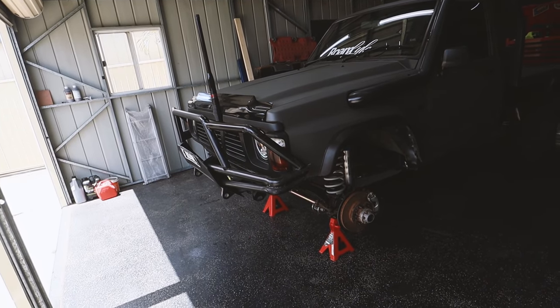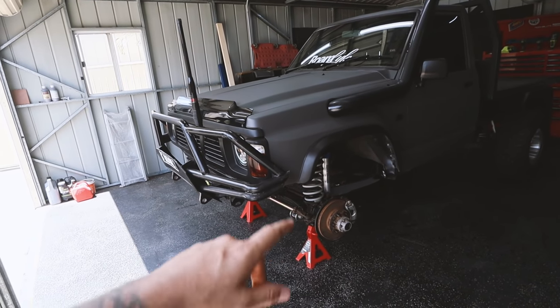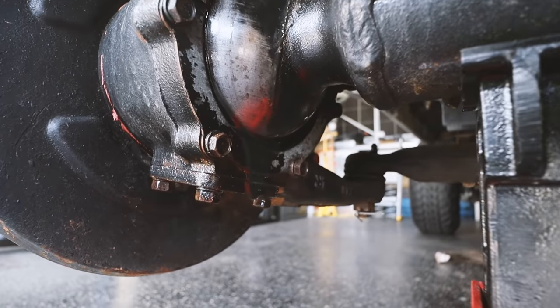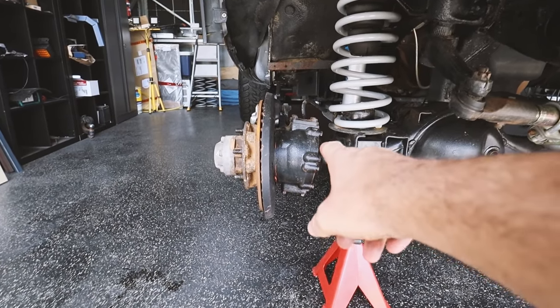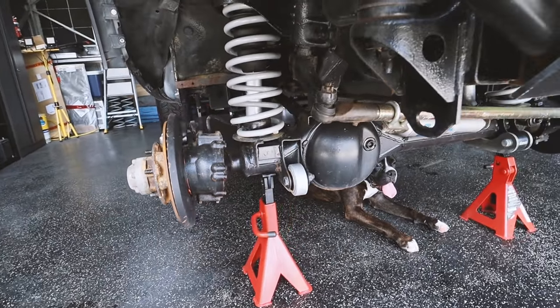That's probably the first thing you should do, because going into the axle side of things, the diff oil can run out. I think my inner axle seals are stuffed, which is why the swivel hubs are leaking in the first place. You can see that hub there is probably the worst one. It's leaking quite a fair bit of diff oil. That's why the seal kit is really good to replace. There's a seal in here that actually stops it. And yeah, we're going to get into it.